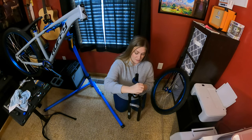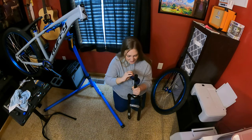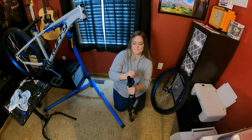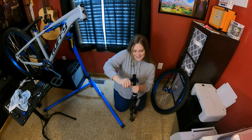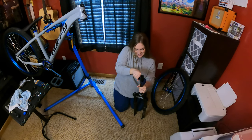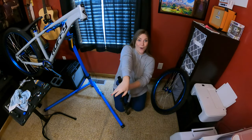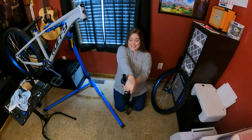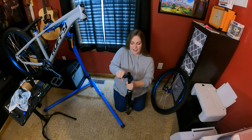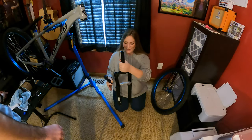So twist? Yeah. You can go ahead and just start going in the circle with it. I'm just real scared. No, you're fine. After you make one revolution, tighten it down, not more. Okay. This is wild. So essentially, you're just slowly etching that blade into the steer tube, more and more. Whoa! Keep going. This is kind of satisfying. So you're getting to the other end. Okay. Gonna tighten it a little more. Oh! Yeah! That's how you do it, folks.